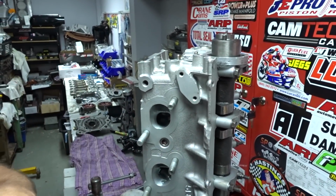So I pull the valve out, take it over to the valve facing tipping wheel and machine a bit off. You sort of get to know how much you're taking off. Put it in, check it. Oh, I've got 10 now. A bit more. And then that's set. And that bucket stays with that valve. Then I do all the inlets the same, and then I fit all the springs up, put the whole thing together and they're done.